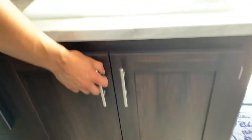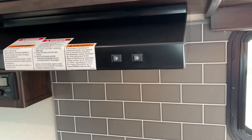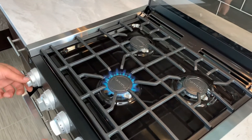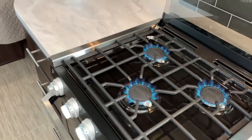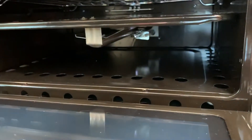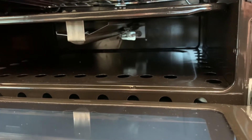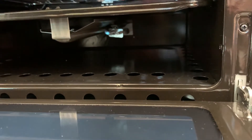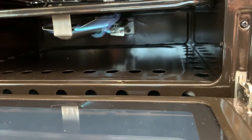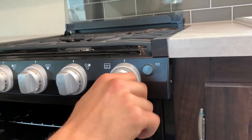There's storage just below the sink. The microwave is fairly standard. The light above your stove and the fan — remember, the propane stove puts off fumes whenever you're using it. The bifold cover just folds back. Turn the dial over to the little flame, hit the sparker, and once it clears the air out of the line, you'll see that little pilot light come in. Once you've got that going, hold the dial in for another couple of seconds, then release it and it'll stay — just select your temperature and it'll fire up. Once you're done, you can bring it back to pilot and it'll hold the pilot light. However, if you're traveling or leaving the trailer for a while, make sure it's right off.